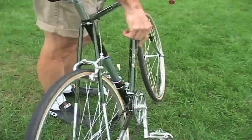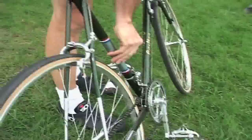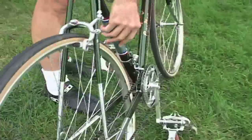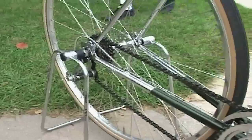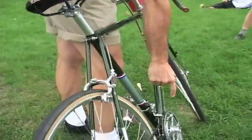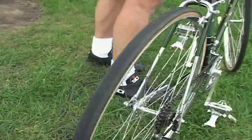The paint's a little weak, but I thought it was in good enough shape to build up. It's got the old-fashioned pull chain Tour de France rear derailleur, and the Simplex competition front derailleur, rod actuated — what people sometimes call a suicide shifter, because you have to reach down between your legs and slap this lever over, and it shifts surprisingly well. I've got it set up with half-step gearing, the sort of gearing that would have been used with these derailleurs at the time. There's a four-tooth difference between the two front chainrings. It's a 14-24 five-speed freewheel, and it gives a nice range of gears, from about a 50 to a 97-inch spread.